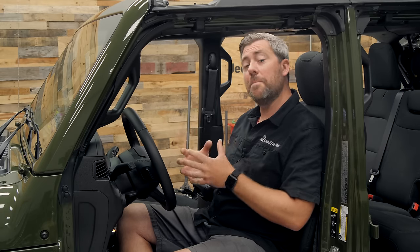Hitting the cancel button again to go through, we can see some of the other modifications we have access to — things like our gear ratio, currently set to 3.45. This is going to come in handy in an upcoming video because we're going to be changing out our gear ratio along with adding things like new axle shafts and lockers to our giveaway build, to make this much more capable when we take it back out on the trail so that the new owner of this Jeep can pretty much go wherever they want. Now the last thing to do in our Taser menu is — as I mentioned, anytime you make any updates or changes — toggle through the menu until you get to that full reboot and go ahead and activate the full reboot again so that we can save that new tire size in the vehicle's computer.